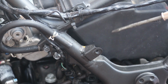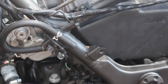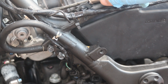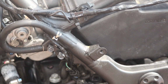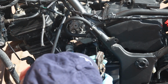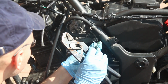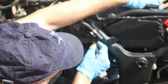Make sure that when you're pushing in this air box, that this part where it meets the carburetor is all the way in towards the little stops of the metal of the carburetor before you tighten everything up. What tends to happen is that oftentimes when I put the airbox back together with the carbs, if there's any hole in that rubber, it creates a vacuum leak, and then the bike is not going to operate well. So now what you want to do is tighten your airbox clamp, which is, for me, here. It's a little hard to reach, but if I loosen it, I should be able to slide it in a much better way than this.